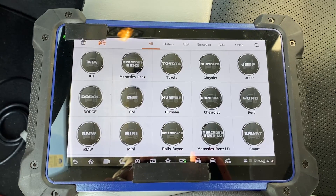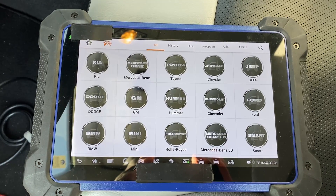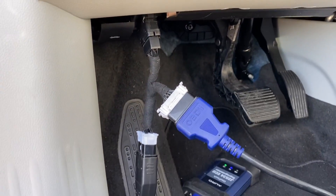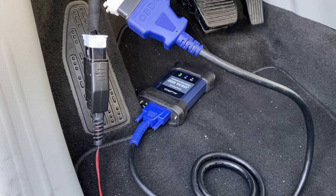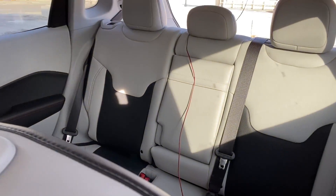What we've done is we've used a standard Chrysler Dodge Jeep bypass cable — just the CAN high and CAN low connection. My cables might be a little different than what you're used to, but the way mine is set up I have an OBD2 Y cable. On one side of that Y cable I have the VCI for the IM608, and on the other side I have my connection for CAN high and CAN low, running throughout the vehicle.